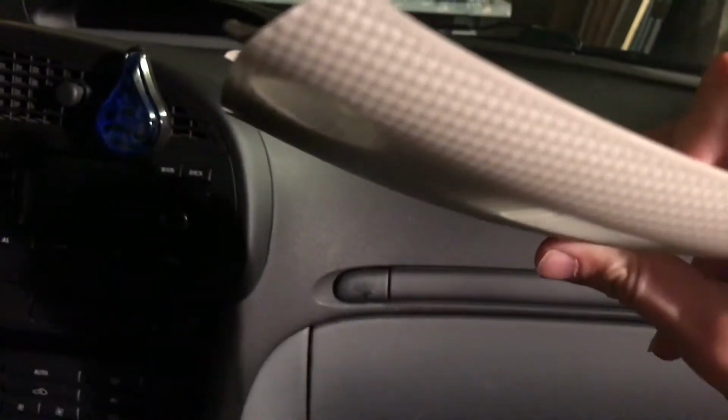As you can see, you have those clips there, and those latches in the front that latch in, so you just pry back here. So in the top here you basically have just four T10 bulbs, as you can see here, 4 of these T10 bulbs, and these are T10 bulbs with 3 Cree LED chips, so it's just called a T10 bulb. So you find a lot of different sorts and brands and quality of these ones also. But one 39mm C5W, and then we have 4 T10 LED bulbs on the top here, and then you just put it back with the latches in here and push it up, and it's secured in place.